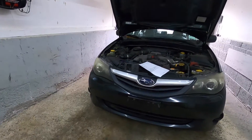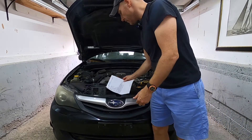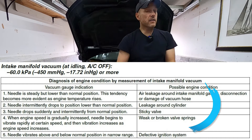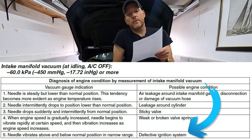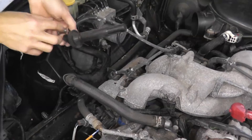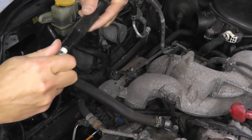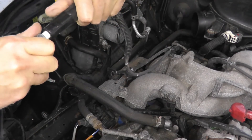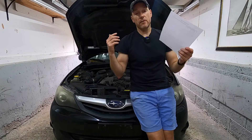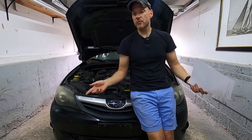The other three readings probably won't come across often, but you can see if you have a sticky valve, weak or broken valve springs, or a defective ignition system. That is actually something I showed a few years ago — this vehicle had a misfire on cylinder one. I went over the steps on how I verified it wasn't the fuel injector, pinpointed it was one of the ignition wires, and I also used the vacuum pump. The needle was a little bouncy because the vehicle was only running on three out of four cylinders. So use this to your advantage.